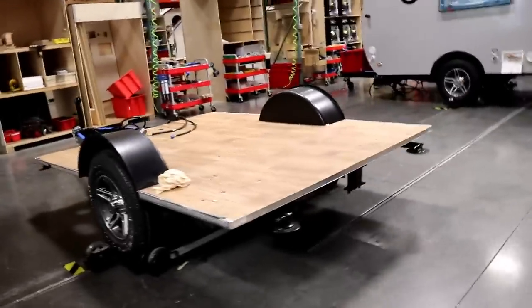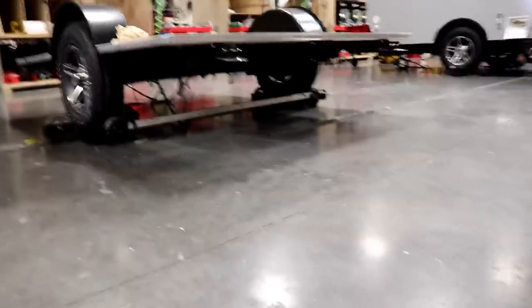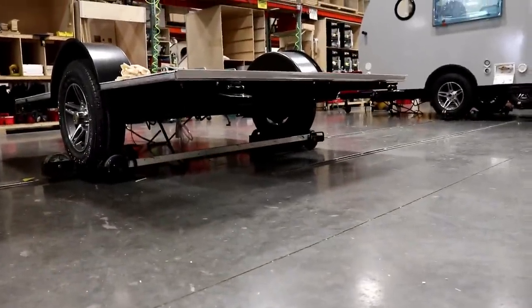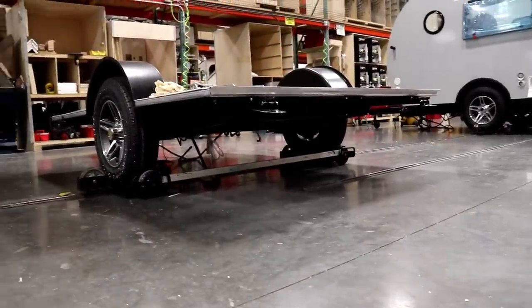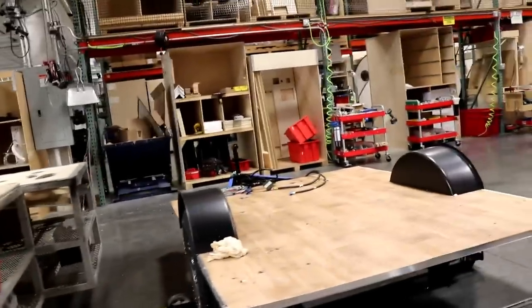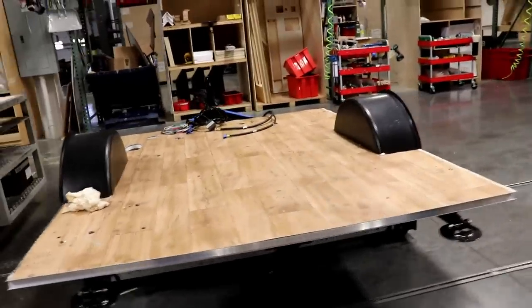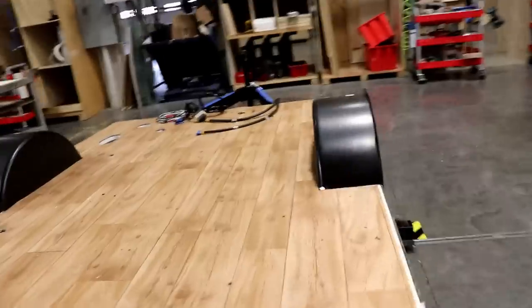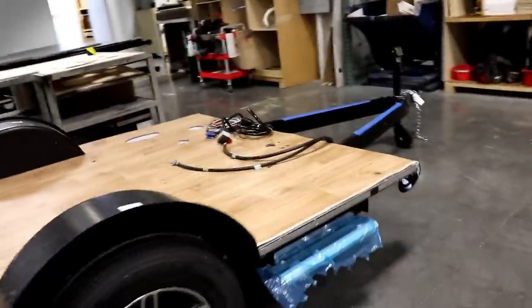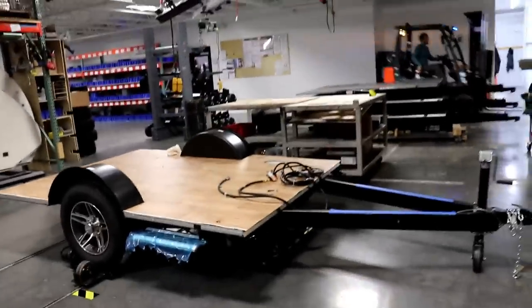Now, once they put it on this table, it's going to be upside down. That is so they're going to be able to put on the things that are on the bottom — the stabilizers, your spare tire bracket, your axle, your front tongue — all that is put on while it's sitting on this table here. Once it's put on over here, that's when they're going to go ahead and put in the flooring color that they need, as well as the wheel wells, and start some of the plumbing and so forth. That is what is done in this particular location.